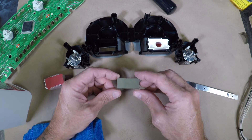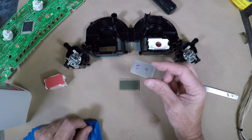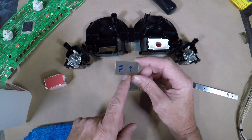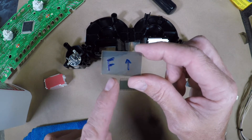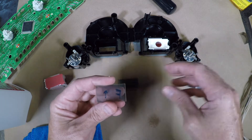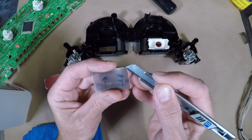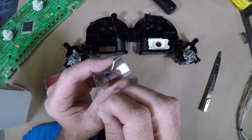Now that it's perfectly clean, you're going to take a filter that you can get from me from the link in the description below. I've gone ahead and got it set the right way. Each one is marked — there's a film on the front and the back. The back is sticky, the front is not, but there's a protective film over it. Each one's marked with an F and an arrow up so you don't mess up. Front, facing up. You're going to go ahead and carefully peel the back film off — just get it started. It's a very low tack adhesive, so don't touch it and don't drop it.